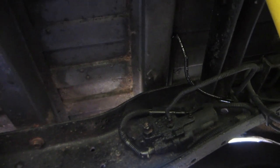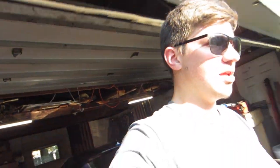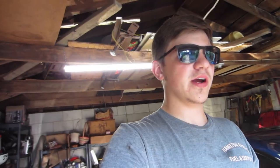Right now I'm just trying to figure out how long of a brake line I need, and it's looking like it's going to be really, really long. So I made an executive decision that I'm just going to try to pull the flex off that line and cut and re-flare it with a fitting, because the line is in really good shape — it just seizes into that fitting. Either way I have to buy fittings, or actually I can just use the old fitting if I re-flare it. So we're just going to send it. I'll catch up to you guys in a second and show you the procedure on how to flare a line.